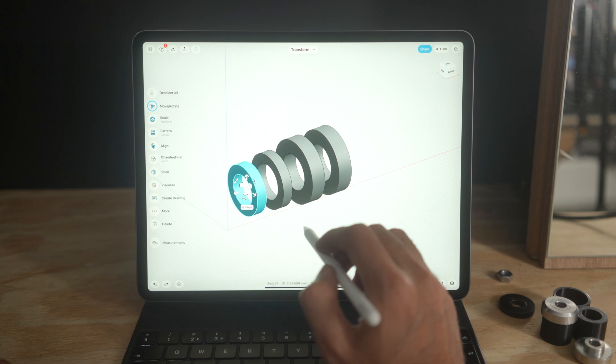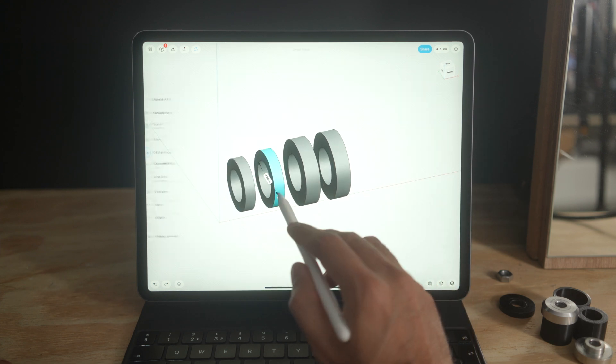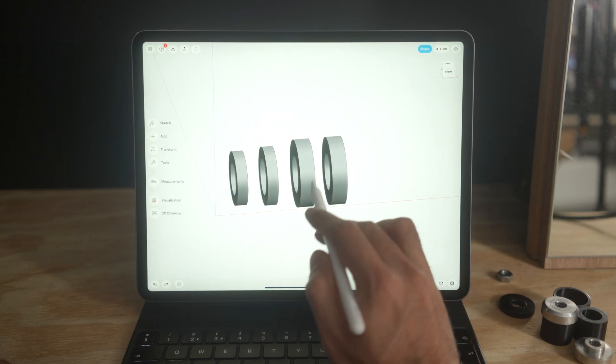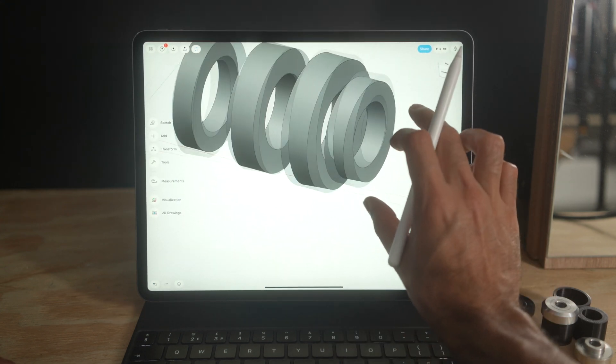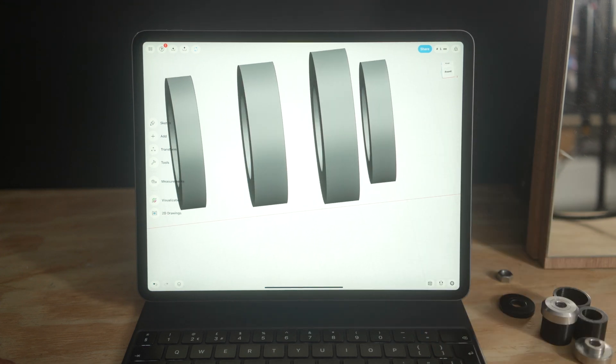The small bearing on the end — that's the 6802 in the Hunt wheel. The slightly bigger bearing, 6803 — that's the CarbonTie and Extra Light I just mentioned. And right at the end, that's a 6903 bearing — that's what DT Swiss use in both their 240 and 350 hubs. Now I'm not going to throw any shade, but I have seen fidget spinners with larger bearings.